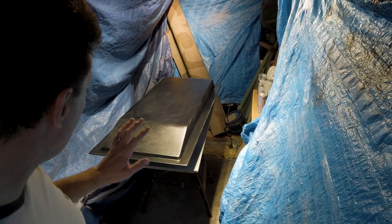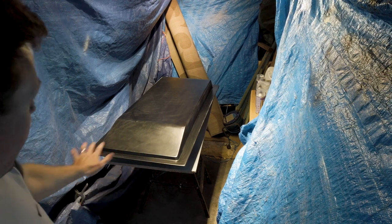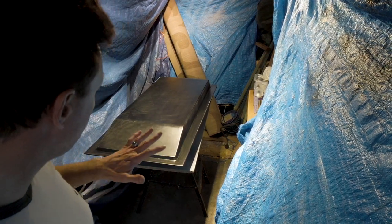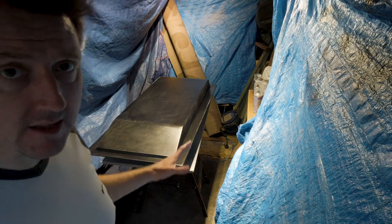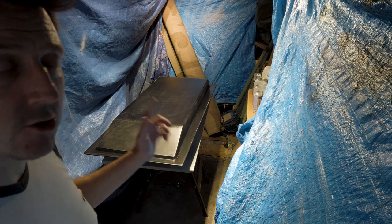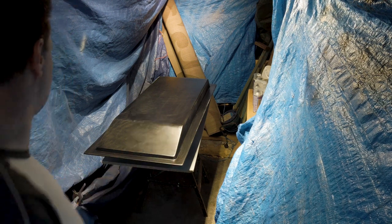As I say, that one's wet and dry. I'm going to give it a good clean now and make sure there's nothing on there that can react with the paint. Once I've got a couple of coats of black on, I'm going to leave it 25, 30 minutes, and I'm going to go straight on to clear and try and clear coat it tonight, build up some coats of clear tonight.